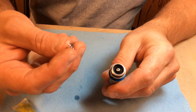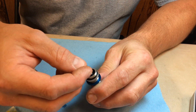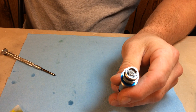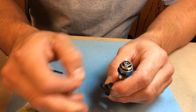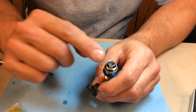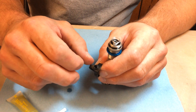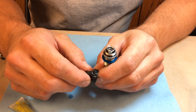Next, you'll take your spring and you can pull the shaft all the way out and click it on the top of the head of that bolt. Then take your cap — we will not run any screw in your bleeder cap. We want to leave that vented so there's no air pressure behind there. Any air that's going to be inside here can breathe in and out with no actual air pressure behind it, because our spring is going to act on our floating piston and we don't want any air pressure in there.